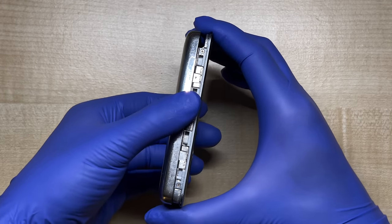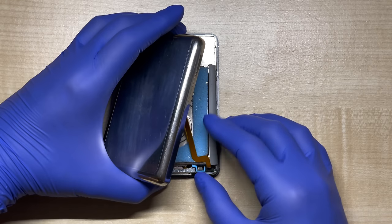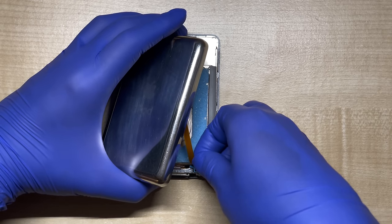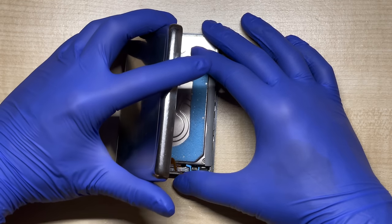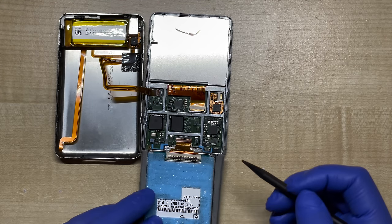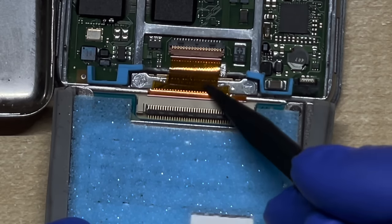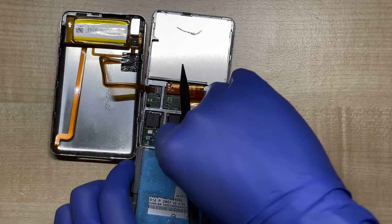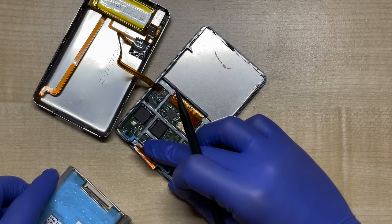Even though the back plate is unclipped, we still can't pull it open just yet because there are still cables connecting the two halves together. First things first, we need to disconnect the battery. The connector is here at the bottom right, and we just need to very carefully pull the ribbon up. Don't use too much force here because it's easy to rip the battery socket off the board. Take your time and just slowly wiggle it out. With the battery safely disconnected, we can now open the iPod like a book. Most of the components inside iPods are connected by ribbon cables with clips, and it's very important to note the location of these clips relative to the ribbon cable. Some of them are on the opposite side, while some of them are on the same side, and if you try prying it open in the wrong direction, you can easily break the connector. In the case of this hard drive connector, the clip is on the opposite side, so we can just flip it over with fingernails and then slide the connector out.